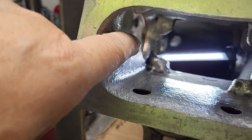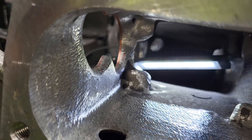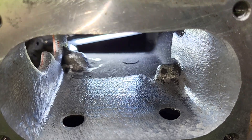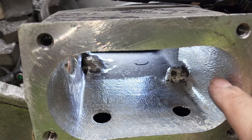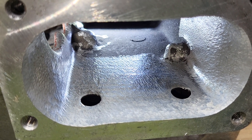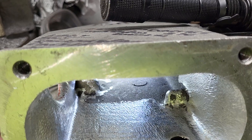It's really going the wrong direction before it enters the port. Right here where you see the tip of my finger has very high speed air because the air is trying to get around that tight corner. That's runner number one - that's probably one of our lowest flowing runners strictly because it's so close to the throttle body. I ran the bench and ran a string through there - you can see even when the air comes through this barrel it takes a hard left-hand turn to get in there. You definitely have to be careful how much material you take out - this gets very thin right there, so pay attention to that.